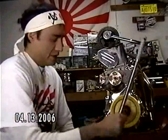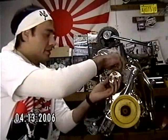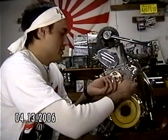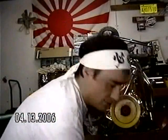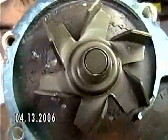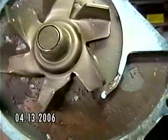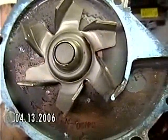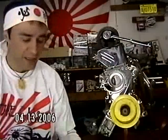This motor went bad due to water going into the oil pan, and it happened due to the front cover cavitation — that was due to not running enough antifreeze. You can see what cavitation looks like, see all the holes in there. This is only 40,000 miles on this GMB stamped pump. You should get the Atsugi brand with the curved cast impellers, but you can imagine what a 30-year-old front cover looked like — I threw it away already.